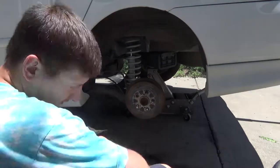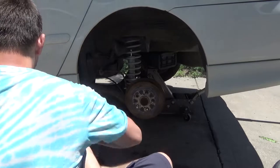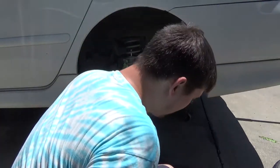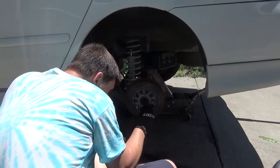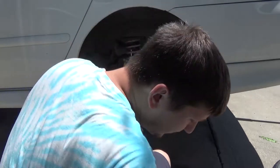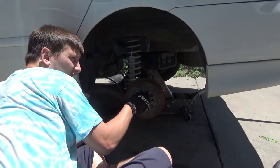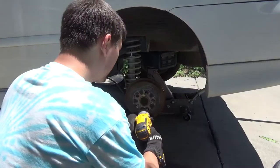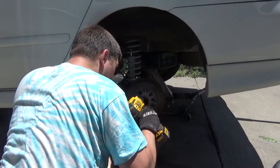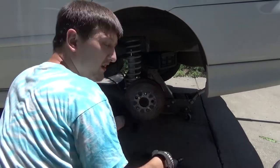Make sure you don't breathe in the brake dust if you can — just ventilation. I'm outside so I don't really need to worry too much about it. I like to hand-thread them in first so you don't strip them with the impact. There's one. The other one I'm going to do up top and go in an equal fashion — just go slow so you don't strip stuff. And as you can see, it came off.